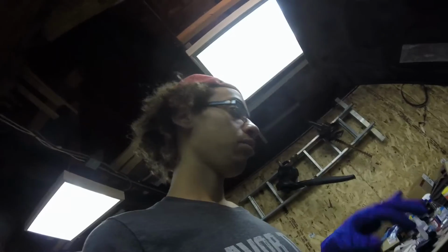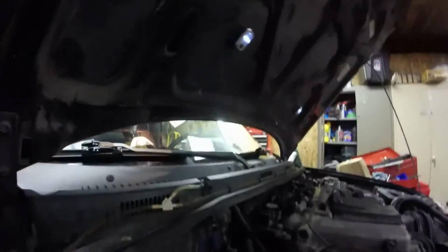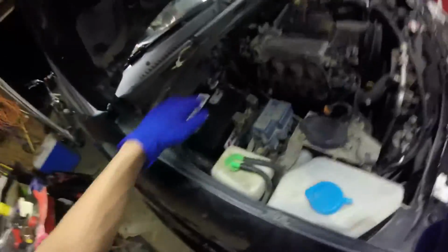But it's no longer dying on idle, and then the problem we had once we got home was that those are pretty corroded. So I'm going to do something that I was told works, which is I'm going to soak those in Coca-Cola, which is what's in that bag. I'm going to soak them at least overnight. So yeah, I think the positive side looks pretty good, but I'm still going to have those soaked too. So that's what I'm doing tonight. I'm just going to loosen up the throttle cable a bit and then soak these in Coke overnight.